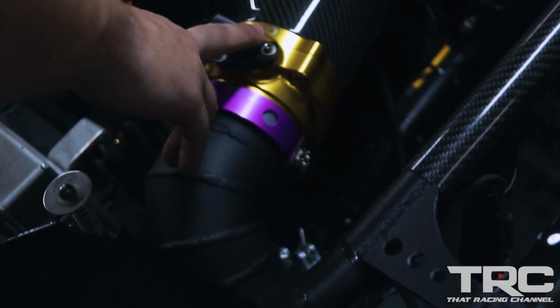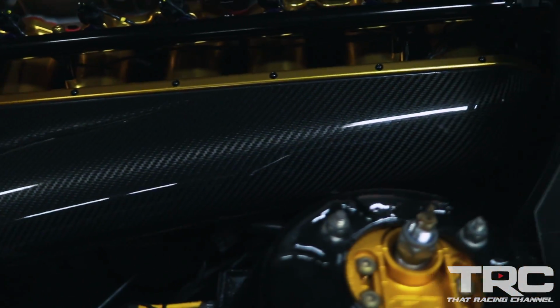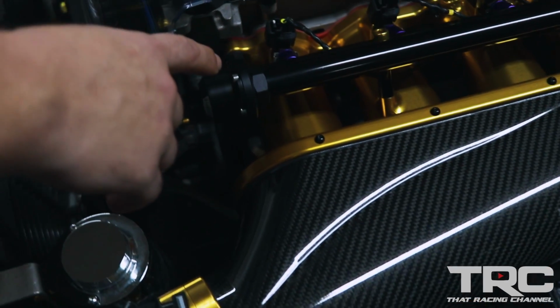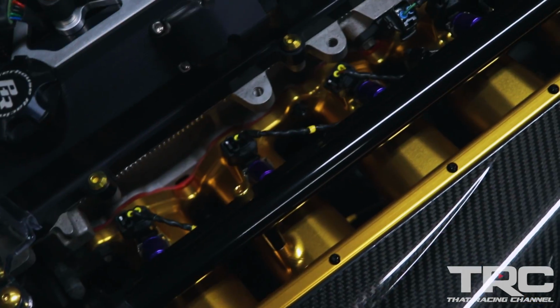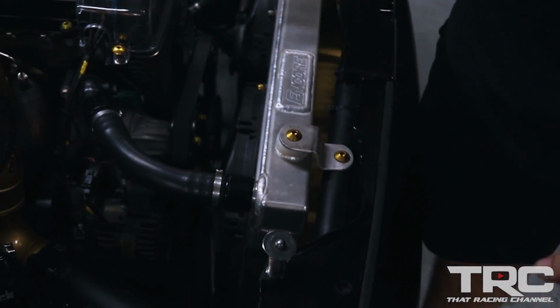The intake manifold comes from Australia, from CPC, from Ariel, Custom Plenum Creations, beautiful work. It was custom made for us, to our specs. We're using 1700 IDX for injectors. There's 6 injectors. Custom intercooler pipes all around the car.